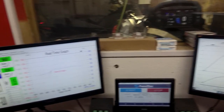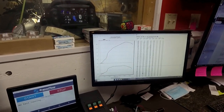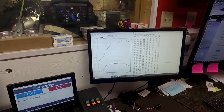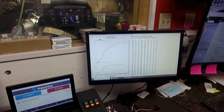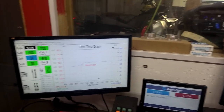The first run always makes a little bit better power than the hotter runs. On that first run it made 184.7 horsepower and 121.3 foot-pounds of torque. The 184.7 was at 8050 RPM and the 121.3 was at 7900. Let's go into the next run.